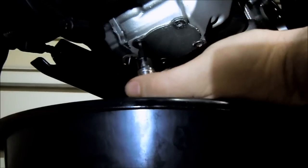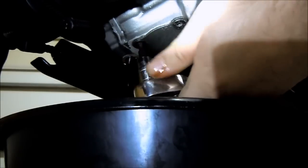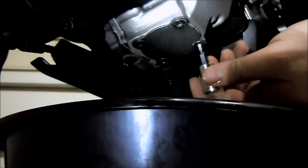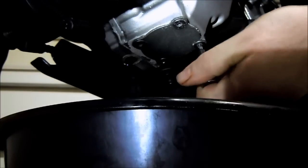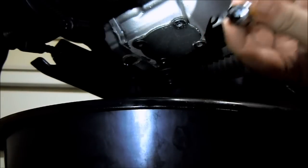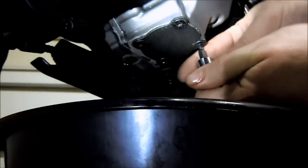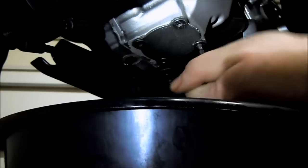These do get glued down a little bit because of the 3-bond, so don't be nervous if they take a little extra strength to pop loose. Also, you want to be very, very careful if you're trying to use Allen keys. Do not use a ball hex, because that can strip out your bolts, so it's best to use a nice sharp edge on these. Then I'll gradually turn these out and come back once I've got all the bolts removed.